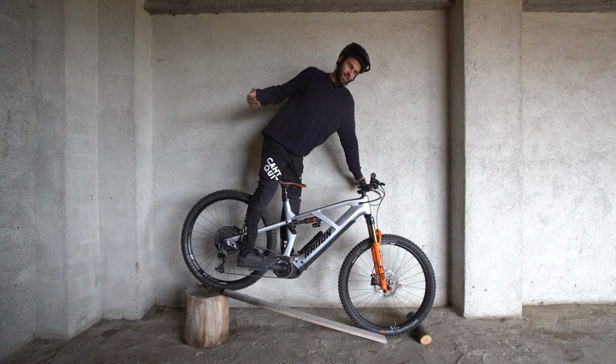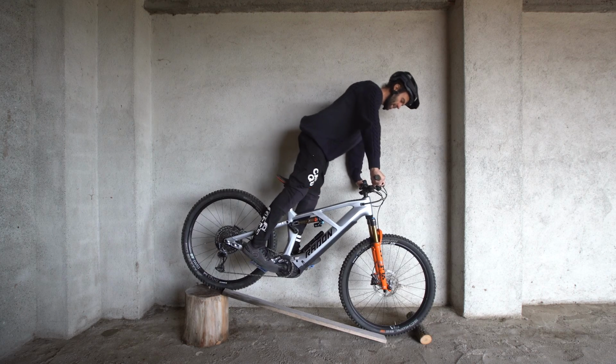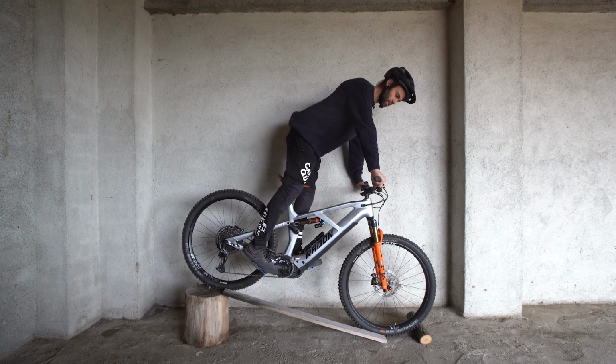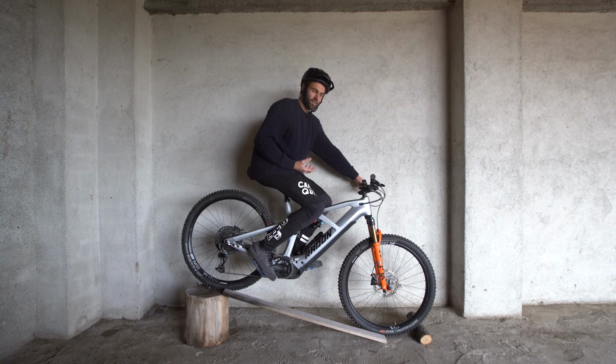But in reality, this means as you're slowing down, and the heavier you are, and the taller you are, and the faster you're slowing down from, the more pitch you get forward, and the more the rear suspension will extend. Again, all pitching you forward, all making life difficult. Why are all these things combined together a problem, and why do they make it more difficult to ride?